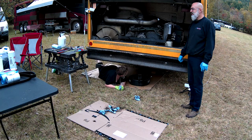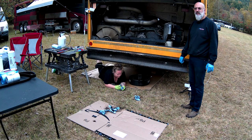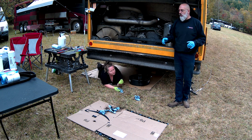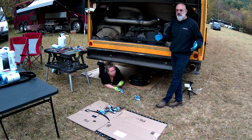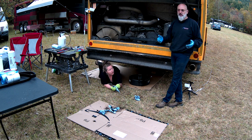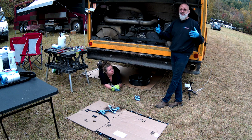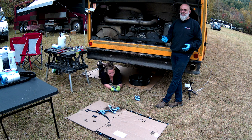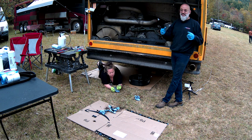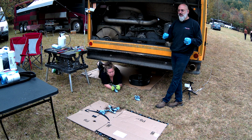Is the oil specific to different buses too? Most diesel engines will use a 15W40 oil, that is specific to diesel engines. If you have an older two-stroke Detroit diesel engine, there's none of them here, but sometimes there are at Swarms. The two-stroke Detroit diesel engine uses straight 40 weight oil, not a multi-weight.